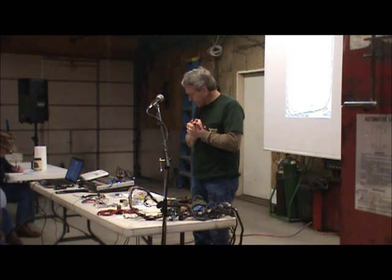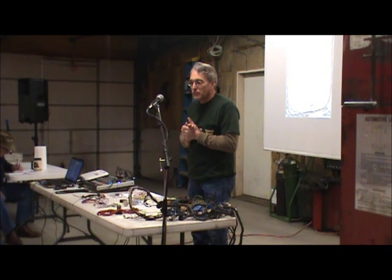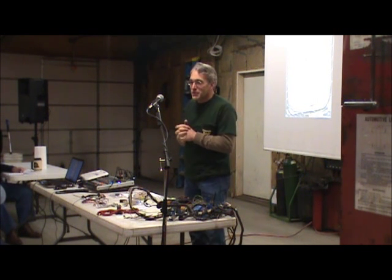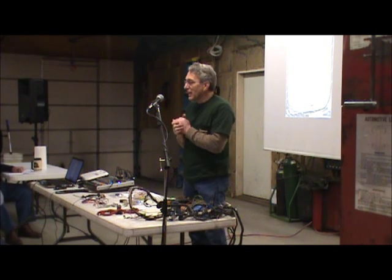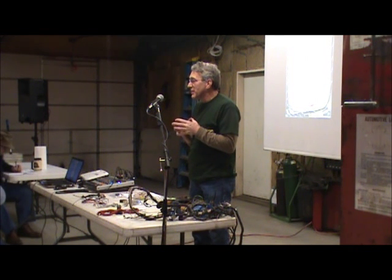I have a question. Yeah. Are you talking about somebody putting in a 20 amp fuse that calls for 15? Yes. Or are you talking about a 15 amp fuse that's not 15 amps. It's more like 50. Okay. Yeah, we've seen that. It's marked 15, but it's more like 50 or better. You wouldn't know. That's the problem. But I think they sort of discovered that, but it didn't seem to be specific to Lucas fuses or the clear hooter fuses, because even some bus fuses were doing that.